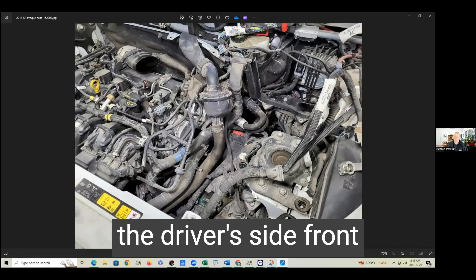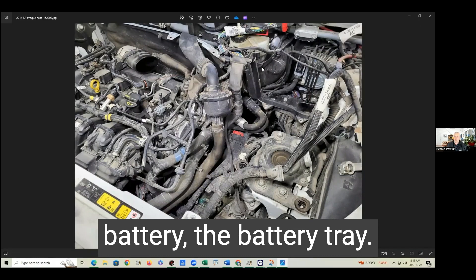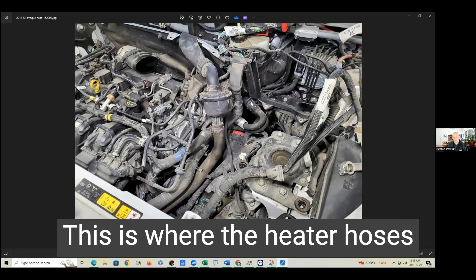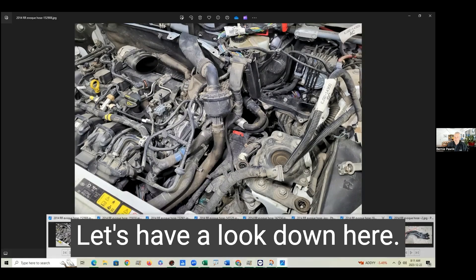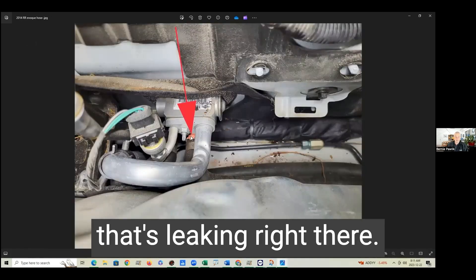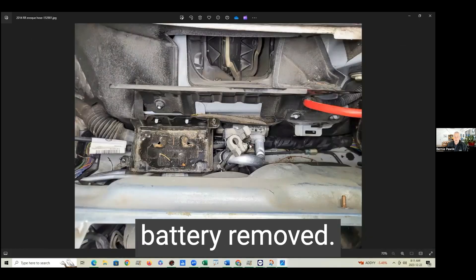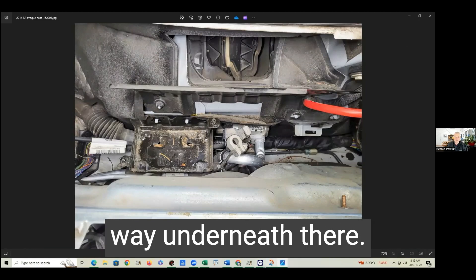This is looking from the driver's side front corner of the vehicle. The main battery used to be here — we've removed that battery and the battery tray. We're now accessing areas where we can see the heater hoses. You can see the PCM has been removed. This is where the heater hoses connect, right here where the mouse pointer is moving. Here's a view down through the cowl — this is the air conditioning pipes, and that is the leaking heater hose right there. There are two hoses clipped on with quick-connect connectors to the heater pipes. You can see the heater hose buried way underneath there.